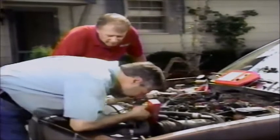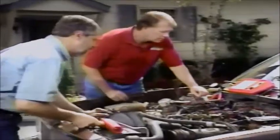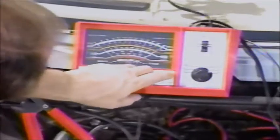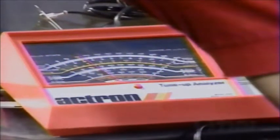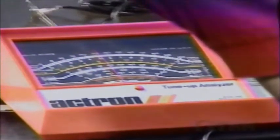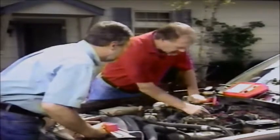With the timing light and about 500 RPM idle, it's reading about 4 degrees - right on what it calls for. Checking at about 2,000 RPM, we've got about 21 to 22 degrees there. The centrifugal is working. Let's check the vacuum chamber and see what our total timing is. Revving it up, we've got about 36 degrees total timing - that's pretty good.